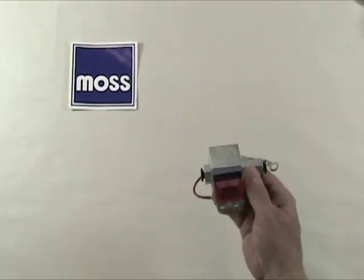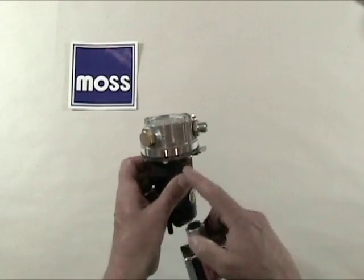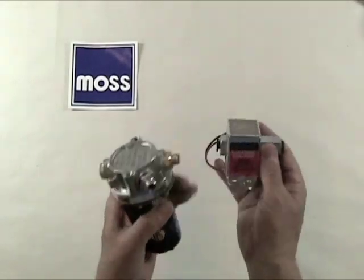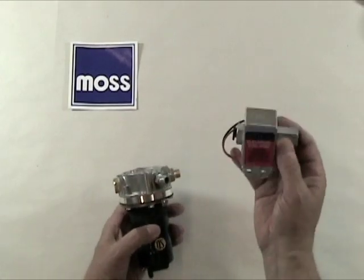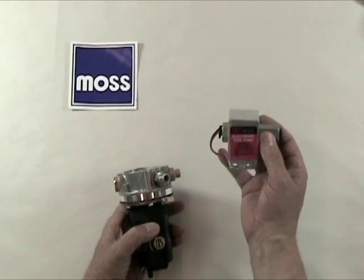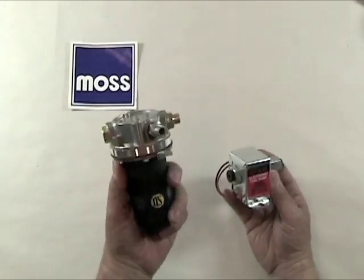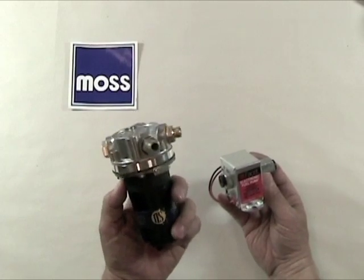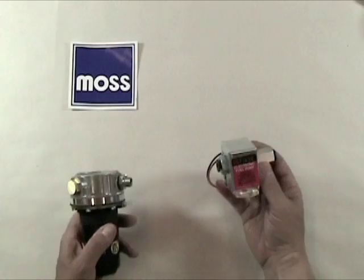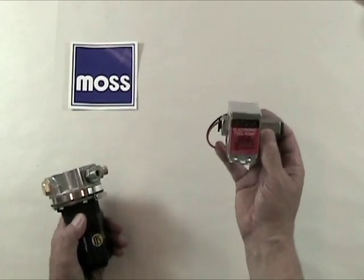Second, the SU pump is a diaphragm pump. There's a diaphragm right in here which is moved up and down to pump the fuel. Okay? This pump is a pulse pump. Diaphragm pumps make the traditional thumping noises, but they stop pumping when the carbs are topped off, and then they just operate intermittently after that, kind of like an air compressor does. A pulse pump is like your heart. It's always pumping. There's no problem with this.